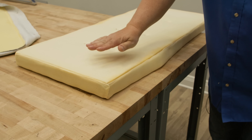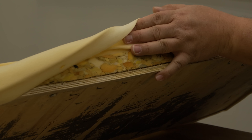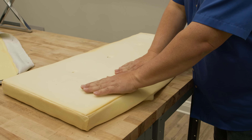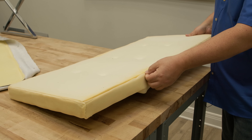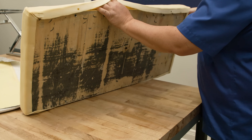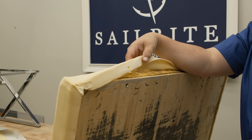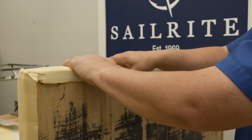We're going to reuse this foam. It's actually not uncomfortable to sit on — it's not bottomed out. It's basically that cheap carpet foam you find underneath your carpet, just thicker, with particles of foam that make it fairly firm. If I were replacing this, I would probably replace it with a high density firm foam in about a two inch thickness. But we're going to use this because it makes the job cheaper and quicker. This foam has been glued and has come up a little bit, so I'm going to use foam lock spray adhesive — shake the can a little bit first. We'll let the solvents evaporate a little bit and then re-stick it down in position.